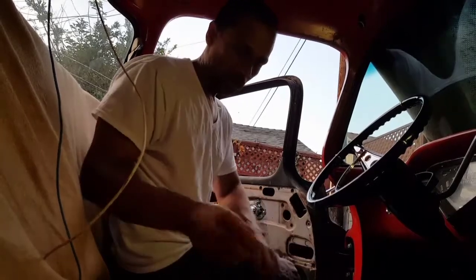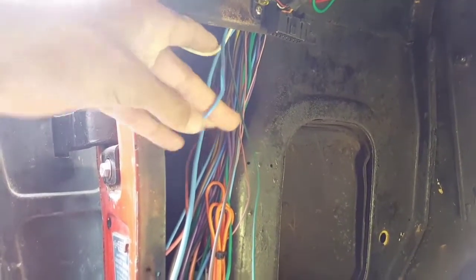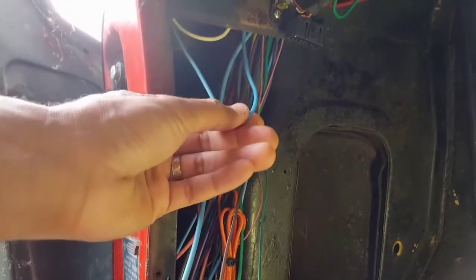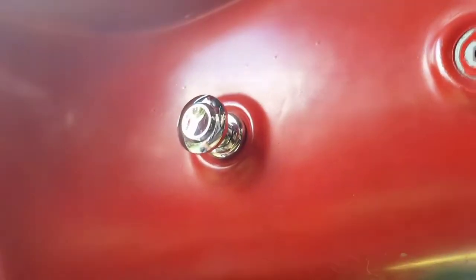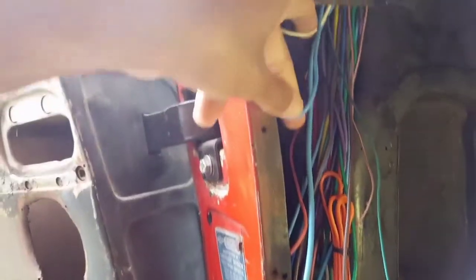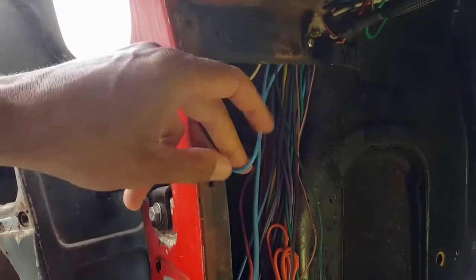I looked over my blue and white wire and realized I had forgotten — the blue wire is actually for a third brake light. I ran them together because of the same length and I think they're actually on the same circuit. Nonetheless, they're both 12 volts constant, and you feed the ground to them triggered either by the light switch or by a door pin, which I haven't put in yet. My intent was always to take the blue wire and use it as my ground triggered by the door pin and the light switch.